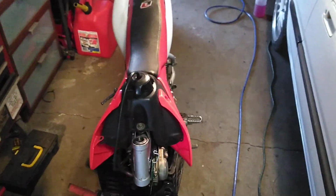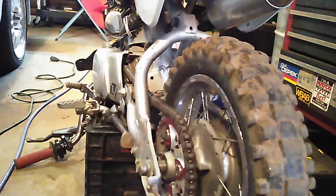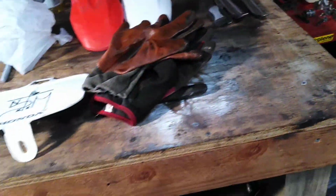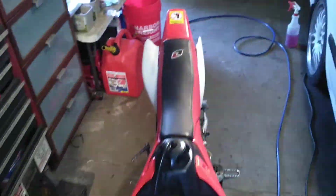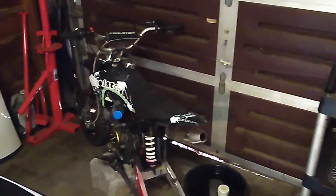I have a 70 motor with the FMF pipe, and the bike is fine. It's got some decent torque. I'm running, I believe, 38 15, if that's what's written down here. Yeah, 38 15 gear ratio, which you don't really have much of a first gear. I mean, slow wheelies, yeah, but second pulls really good. If you throw the bike up in second, you hold wheelies at a pretty consistent speed. And third also.